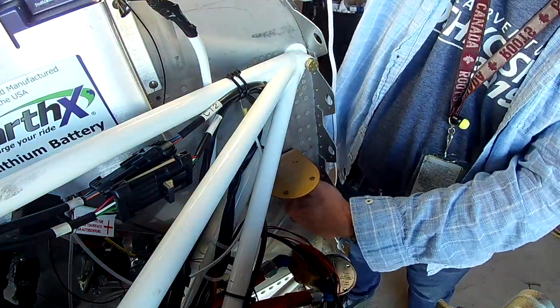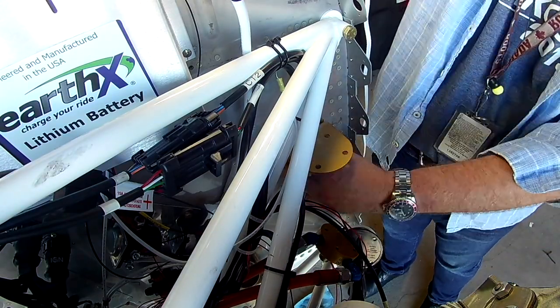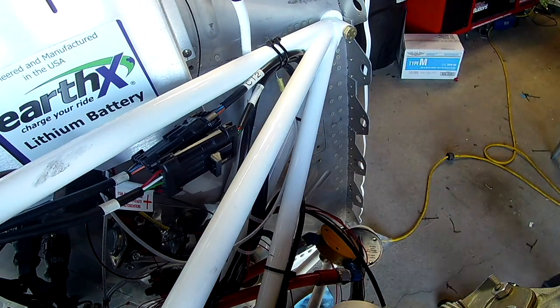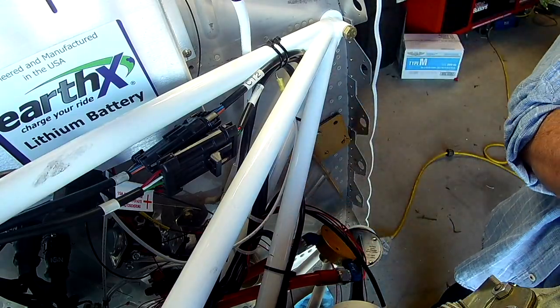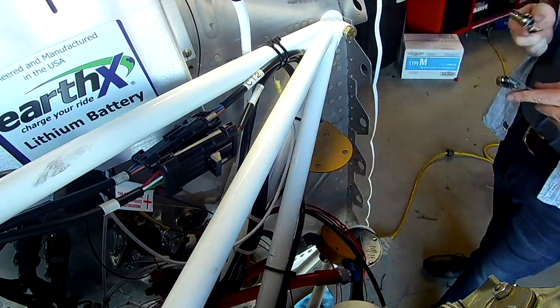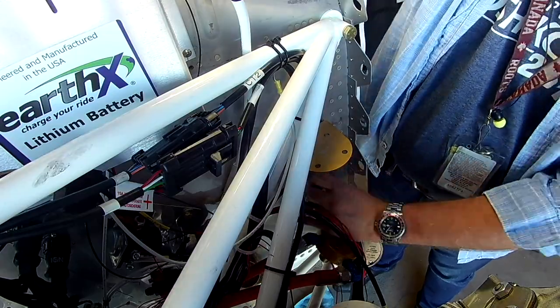That's why Aircraft Specialty makes the hoses perfect for this. It's a very simple install — you just put the hoses on and then let the hoses dictate where the best placement for the filter goes onto the firewall. The trick is you want to have zero stress, because you're already putting holes into your firewall. There is a big doubler that goes in and we are definitely installing that, because torquing oil filters on and off, the engine running, and the pumping of the oil will put stress on the firewall. So you want to make sure you don't drill any holes until you've put the filter in a nice neutral location.